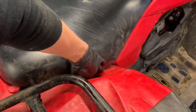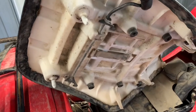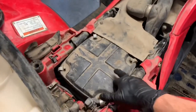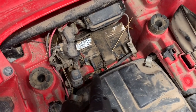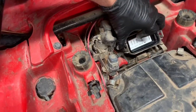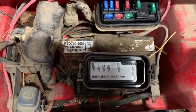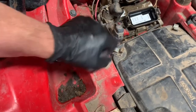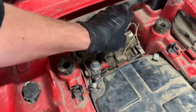To undo this seat here, you've got a latch on the right-hand side in the back. Just reach your hand underneath and pull up at the same time as you pull this latch — that releases these arms. Right underneath here is your air filter; we want to inspect and clean that every time we service our four-wheeler. Here's our battery — it's a YTX-14BS model, a sealed battery. Right underneath here are the fuses. There's a light fuse, fan fuse, auxiliary fuse, ignition fuse, a 30-amp motor fuse, and a 30-amp main fuse. There's also a 40-amp fuse here which I believe may be for the power steering. Make sure all those fuses are in good condition before you go out to ride.